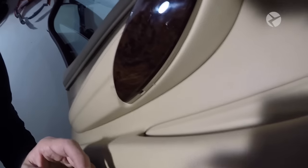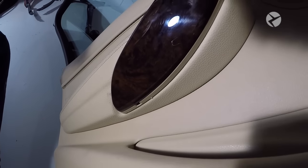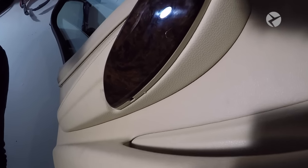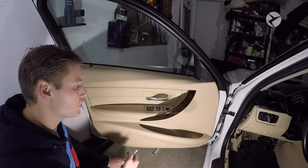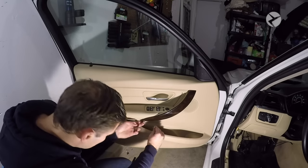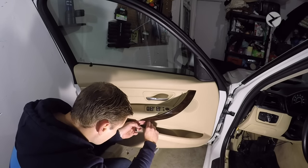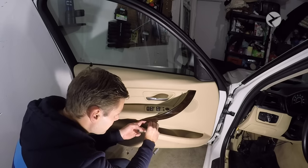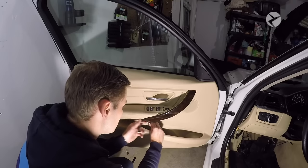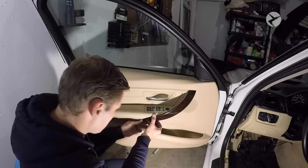To do this, look under here and you'll see a very small hole. This hole gives you access to a metal clip that's holding it in place. If you don't release this, you will break off the bottom clip. Find something small enough to maneuver into that hole — I have a T25 key. Just very carefully insert it straight up and you're going to feel a metal clip inside. Push that out of the way, release the bottom, then slowly go along with your hands to the top and slide this piece out.